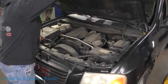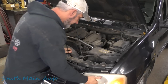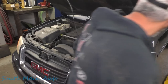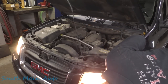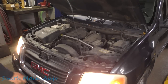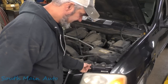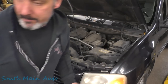We don't want to fall into the trap of it just needs two bulbs. I assume somebody has probably checked them — I don't know that for a fact — so we're going to check ourselves before we get too carried away here. Let me throw the high beams on. High beams look like it's the lower bulb, so this upper bulb must be our low beam. I'll put the low beams back on, because I'm sure it would be something — just to find out if the thing needs just a couple of bulbs.